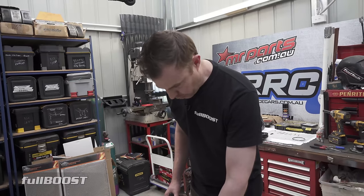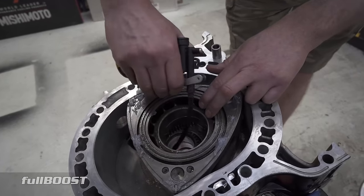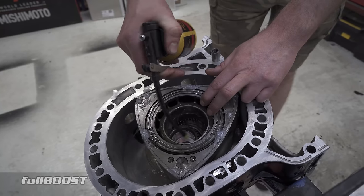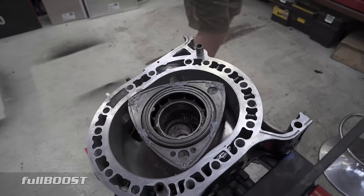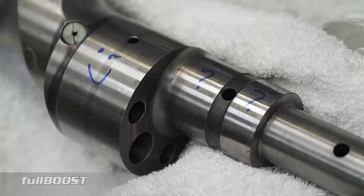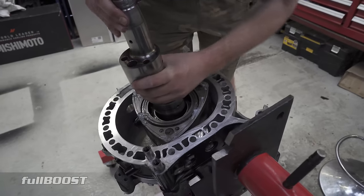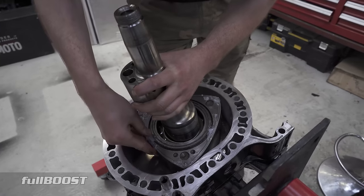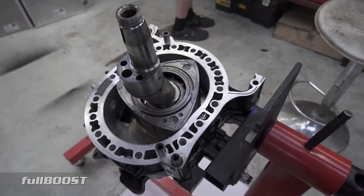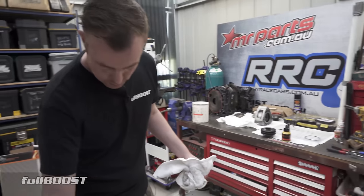Before I put the shaft in the hole, I've got to lubricate the bearings. These aren't brand new bearings, but rotaries aren't overly hard on bearings anyway. This is my race engine — it was originally a standard engine from the FD, which already had new bearings in it. So if anything, they've worn in a little bit, which is even better — slightly more clearance, which is great. I'll pump a bit of oil on here. Time for this to go in. When I'm putting this in, the shaft will locate and dictate where everything has to go.